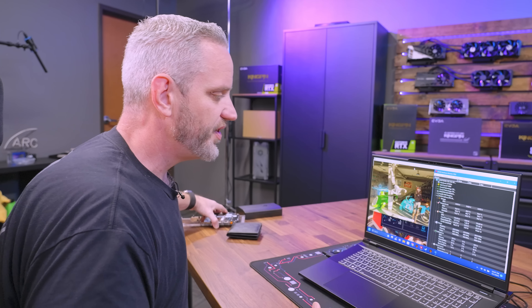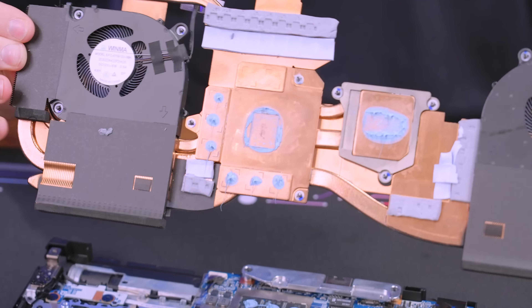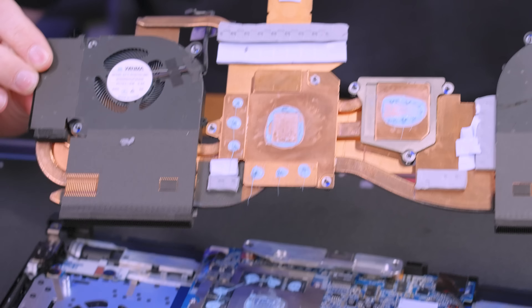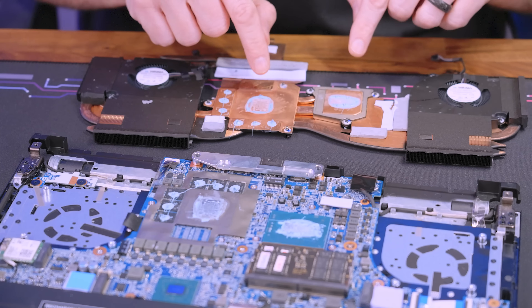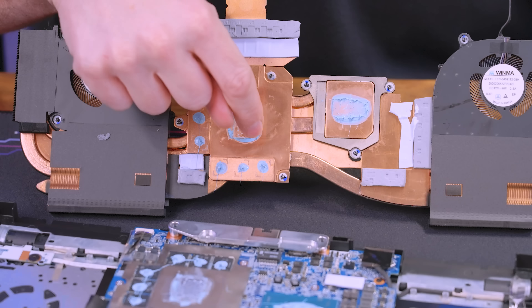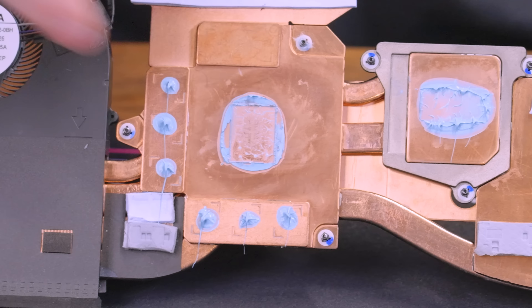There's been a lot of discovery about inconsistencies on the Clevo cooler and their installation process — that thick clay pad they use is honestly just a lazy fix for some manufacturing tolerance problems. Opening it up — yeah, look at that. There is no spread on the memory at all. But look at the GPU — the GPU spread is perfect. Of course, because nothing on the RAM was making contact — there was no spread at all.